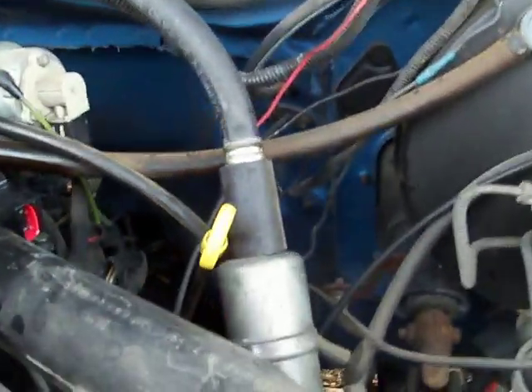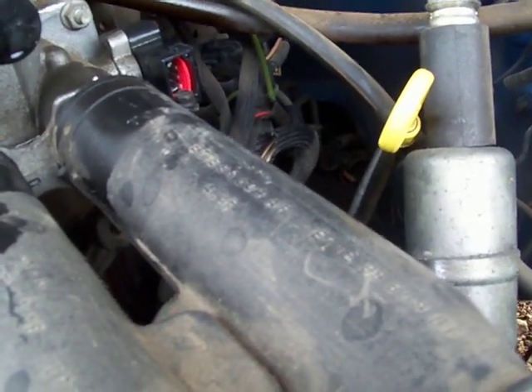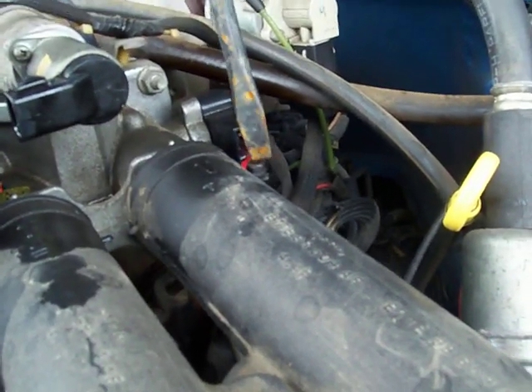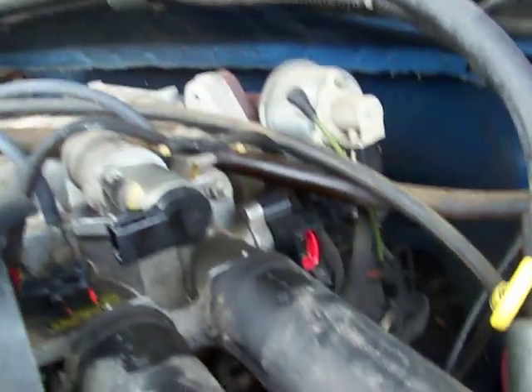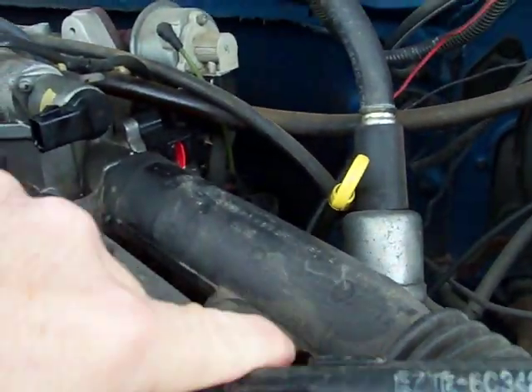While that is drying, take your hoses, take a screwdriver and check the hoses. That one was loose. And let's look here — yeah, that one is loose too. Of course, that's not really too much of an issue on these older ones like this, because these do not have a mass air flow sensor.